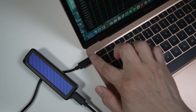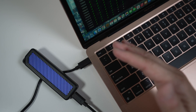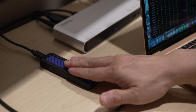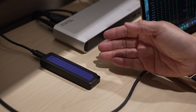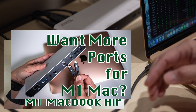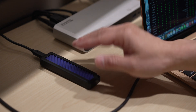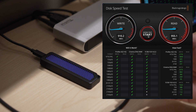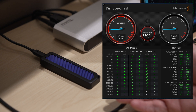By the way, even though the USB ports on M1 Macs are specced up to 10 gigabits per second, they're slower than those on Intel Macs for some reason. The workaround is to connect the drive through a Thunderbolt hub with 10 gigabit per second USB ports, like the one I've reviewed before — I'll put links to those videos in the description. Going through the hub, I get about a 10% increase in transfer speed at around 910 MB/s write and 957 MB/s read, which is again quite a bit faster than the Samsung T7.